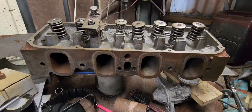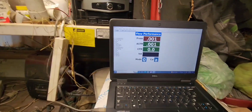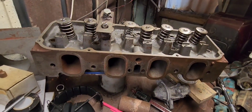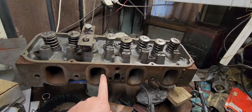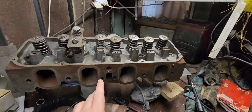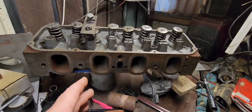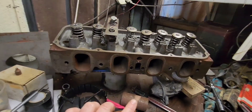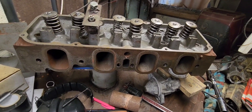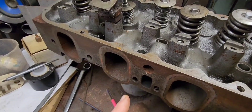Hello, welcome to the channel. For today we're going to try and demonstrate on a flow performance flow bench the effect of what happens when we take a 4V cylinder head and we add port stuffers. We're going to see what it does for flow, take some readings, and work out the hows and whys this might have worked. I've done some preliminary playing around and from what the flow bench tells me this isn't really a good idea, but let's get into it. The valve is set 0.65 inches off the seat and at that lift it's flowing its maximum capacity.